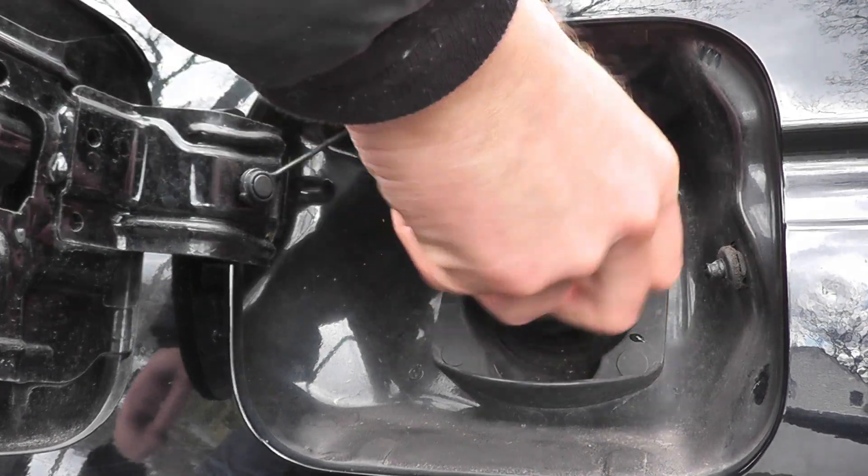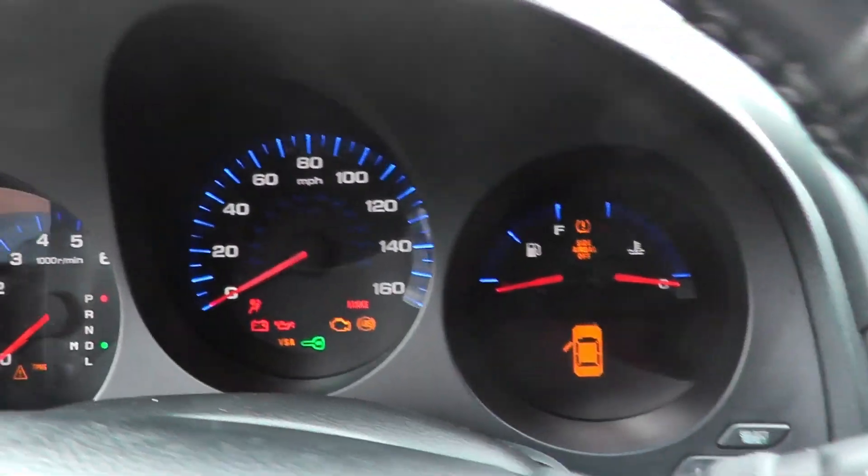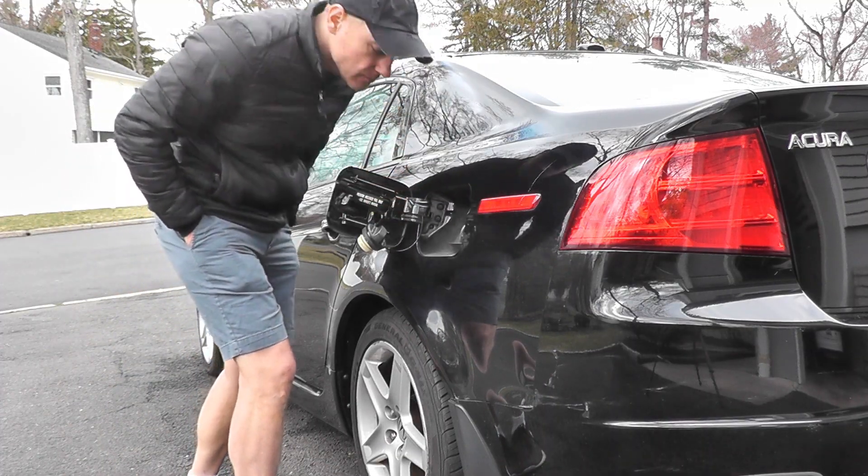Today I'll be showing a number of different things you can do at home to pinpoint why the fuel pump is not working in your vehicle. If you're not sure if the fuel pump is turning on, this is the easiest thing to do: first remove the fuel cap and then have someone turn the ignition key — you should hear some noise for roughly two seconds.